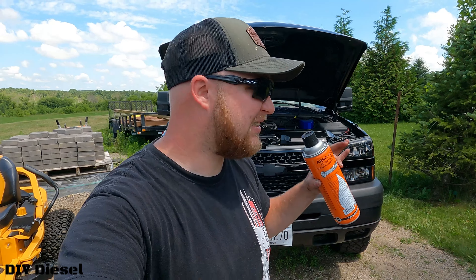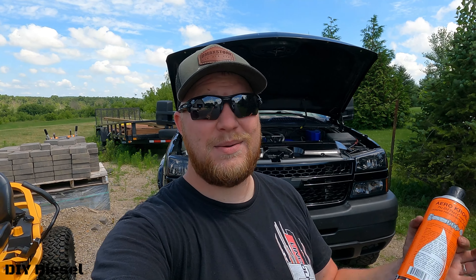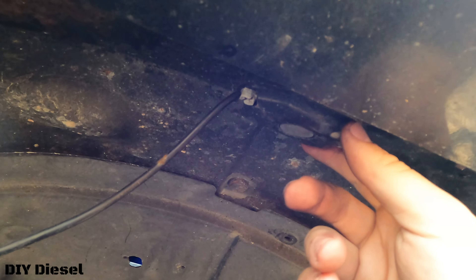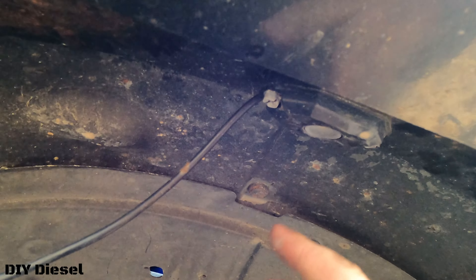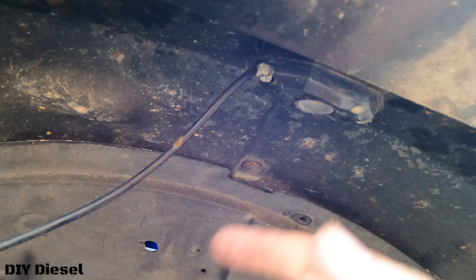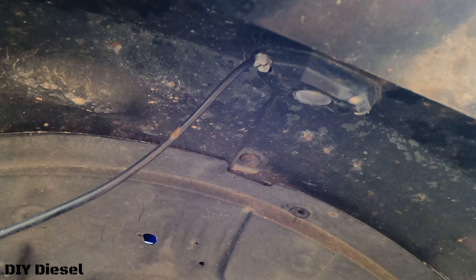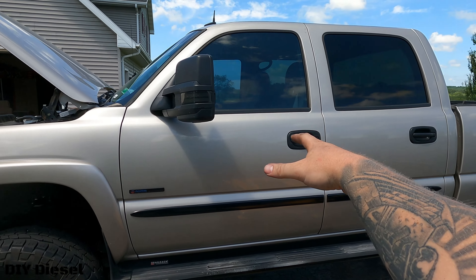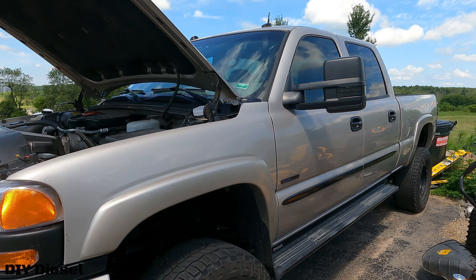Now for the reason why the truck has died so many times — the first few times it was a gelling issue, trying to crank it over until the batteries just said kaput and were done. All the other times have been an issue with those rock lights I put on about a year ago. At this point I have completely disconnected them. I basically waited until they died this last time and said enough is enough — the batteries are kaput, and we're going to get rid of these rock lights. They are not the quality of the new ones, that is for sure.